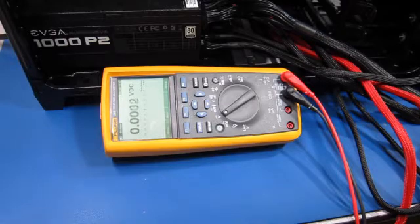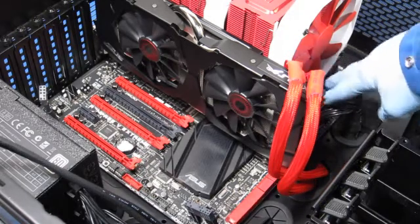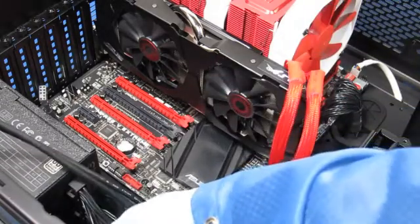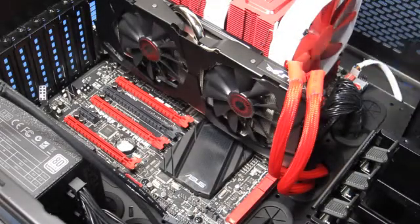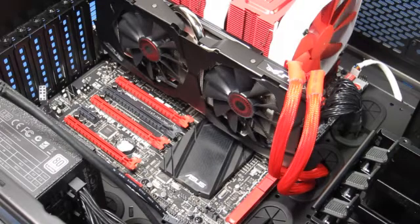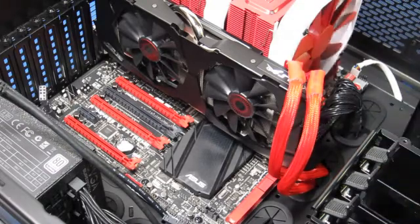The cables seem to be good, so we're going to route all the cables and plug it in and see what happens. We've routed some cables around and put in the main power motherboard connector. All the cables that were on the front we routed through the port opening into the back and then brought them back through the other ports, so they're nice and tidy on the back. Having a case like that and being able to run wires on the back really opens up and decongests everything.